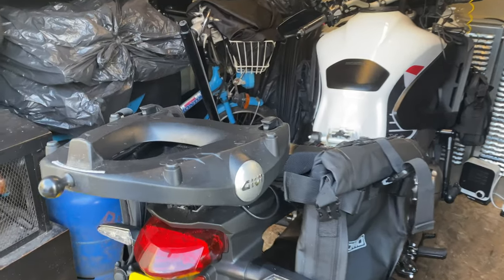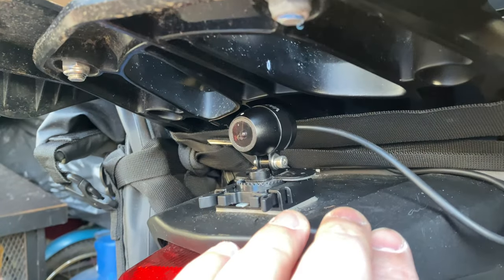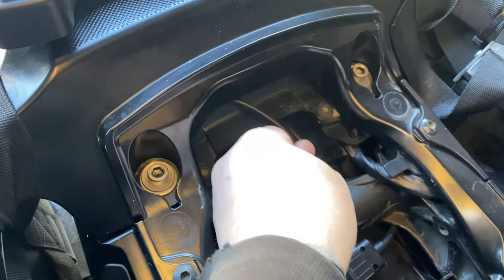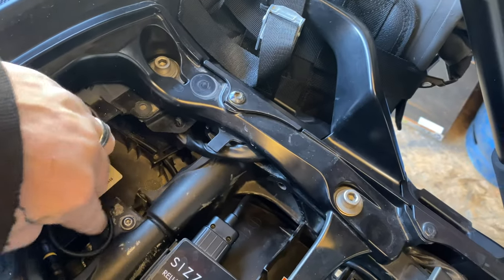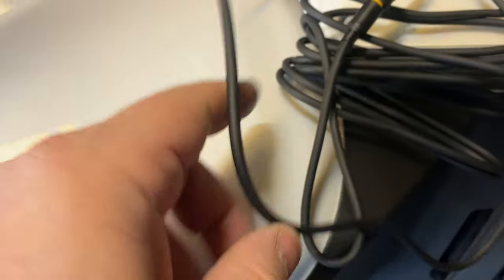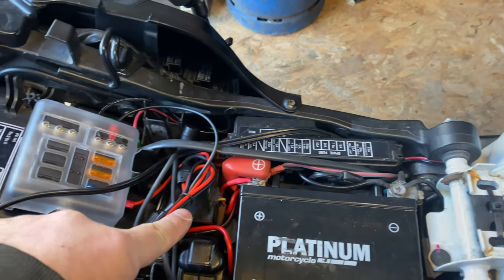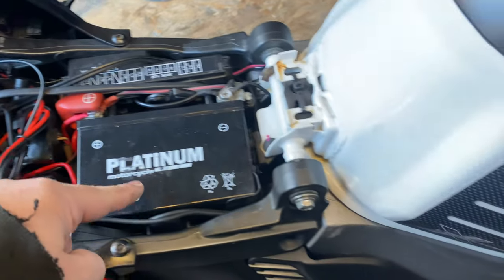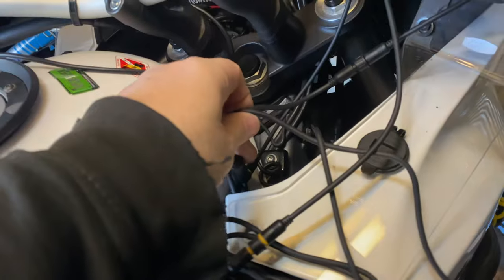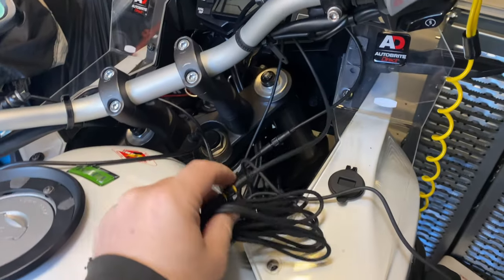So we've installed it. There's my rear view camera — it took a deal with pulling that wire through. That's my rear view camera wire, it runs all the way down underneath the tank, up beyond the side panel. I've wired in my switch live. Up to the front — I've got the front camera fitted. All the wiring comes out here at the moment. All I need to do is bury all this behind this panel.